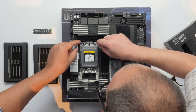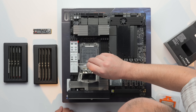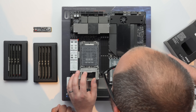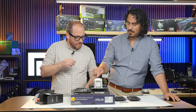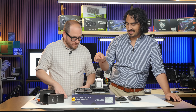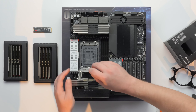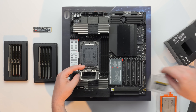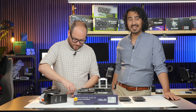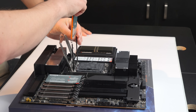You can slide it right up — there's the frame it slides into, and there's also a socket cover. You can remove the shielding, then slide it in. When you're ready, remove the socket cover so the pins are exposed for as little time as possible. The CPU is on a carrier frame — slide it in.